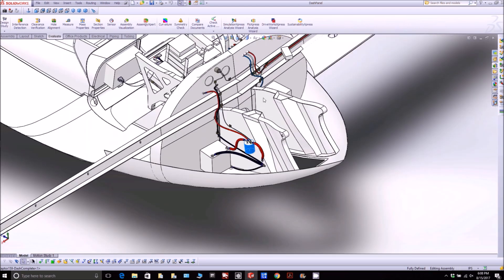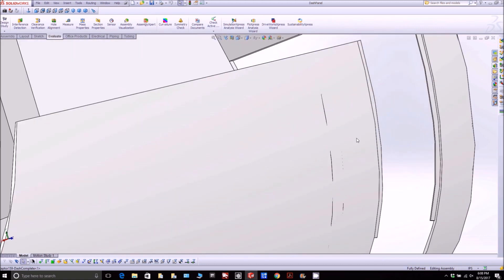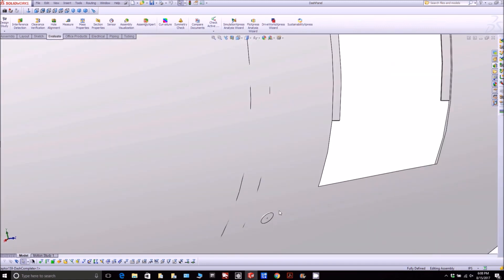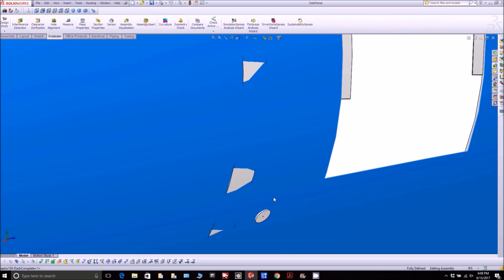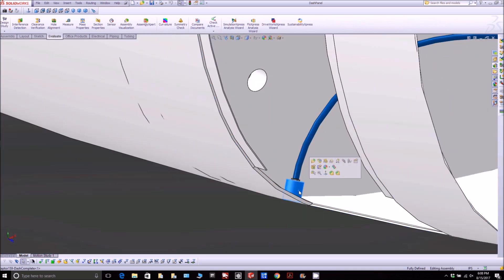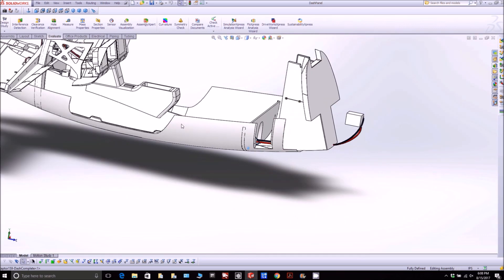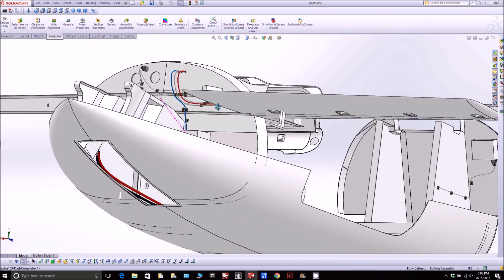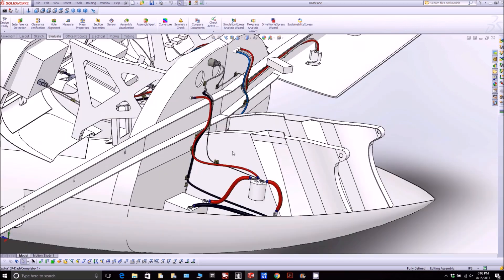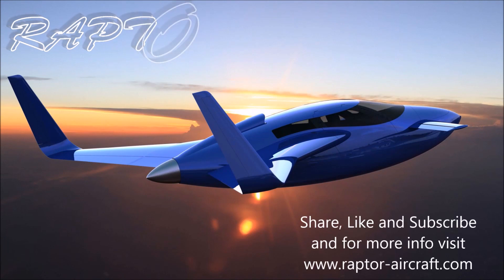You can see I moved that battery contactor solenoid and made it much neater and tidier than before. Lastly, with the pitot-static system, the static port is located back here on the fuselage towards the rear, near where the gear is going to be — I think that's a good spot because you won't get any convergent flow around the fuselage there as you would if you put it at the front. Still a lot of work to do, but that's our update for the first half of this week — thanks for watching.